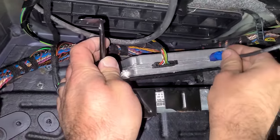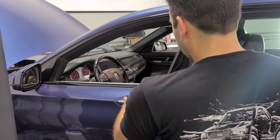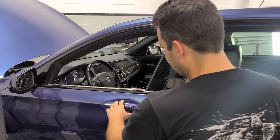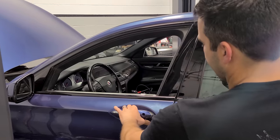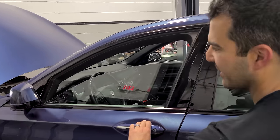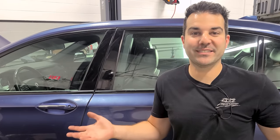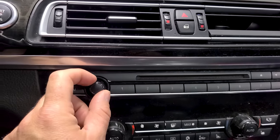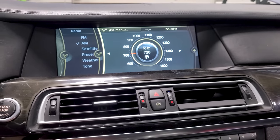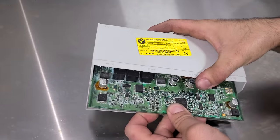The LED light in the door handle is now on - that was not working before! The keyless system works now - keep the key in your pocket and you can unlock and lock it with the handle. That system did not work before. Hold it and it'll do the windows and mirrors too. After erasing all the codes and resetting the control units, we now have audio - everything works from the speakers.